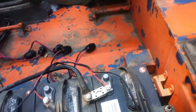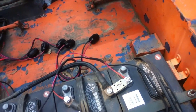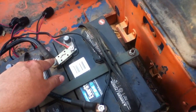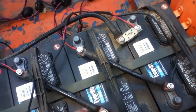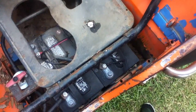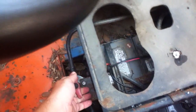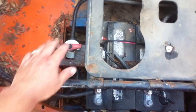You're going to start with the very first one. There's a fuse on here, so if anything goes bad, the fuse will blow and will keep my more expensive motor and controllers from blowing up. Then it goes negative to the next positive, positive, negative, positive, negative, positive. Follow that negative — it's going to go to the positive of the battery underneath the seat until you have them all wired together. Then you can see the positive one runs through a switch. This is just a quick disconnect switch so that you can shut off the power immediately. It's an emergency disconnect so that if something happens, I just hit that.